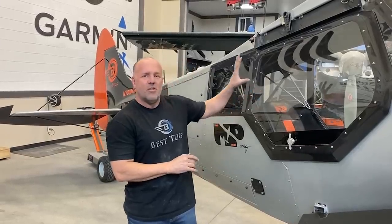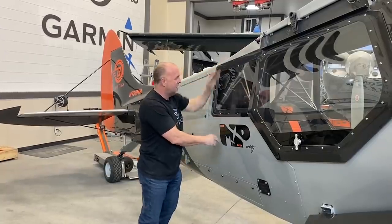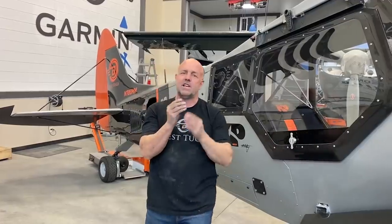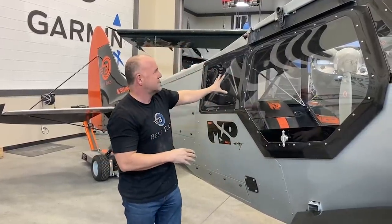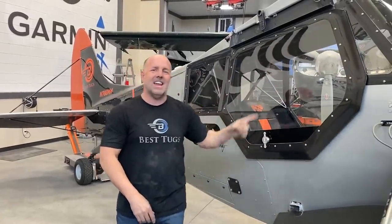But the frame itself is designed to be a knockout frame. So unlike this window, which is not designed to knock out, when these screws go in, they actually pinch an aluminum C-channel and they pinch the window in place and that window is locked. This one obviously is openable, but that side I needed a safety egress.